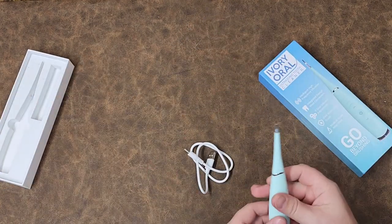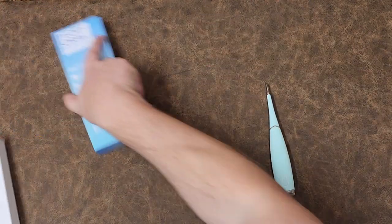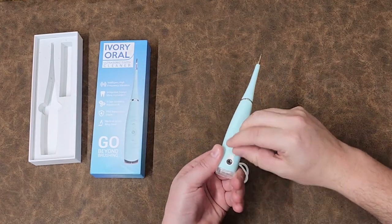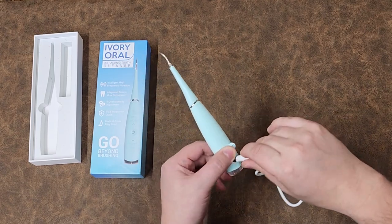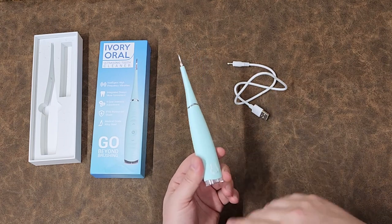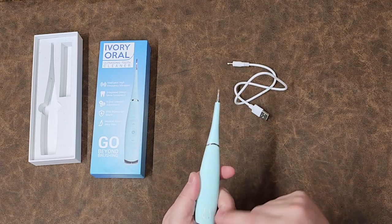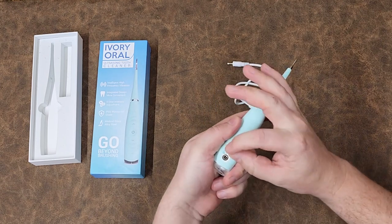Let's take a look at this. It comes in a neat package. It is a USB-chargeable device and it's actually very lightweight. On the back you can see it's got a port down here — that's the charging port and it looks like it's a 2.5mm barrel jack. The only reason they did that is for a watertight seal, because a USB port with its pins so close together is much more difficult to seal than a round connector.